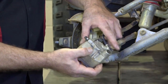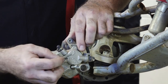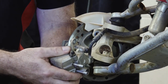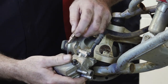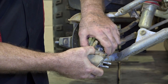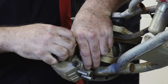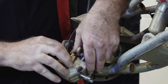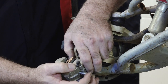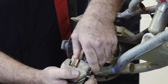From this point we want to go ahead and put our pins partially back into our caliper. Don't let them protrude all the way in, because you actually have to put in the pads and then push the pins through the pads. This can get a little tricky. Make sure that the shim faces toward the actual cylinder itself. Put on the outer pad like so. Then you actually have to push the pads in or down on the spring while you're pushing the pins through. There goes one, and there goes the other.